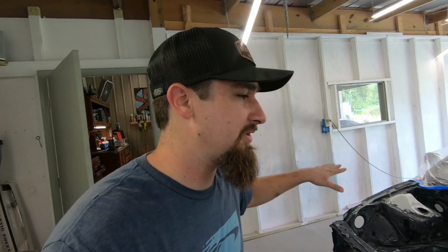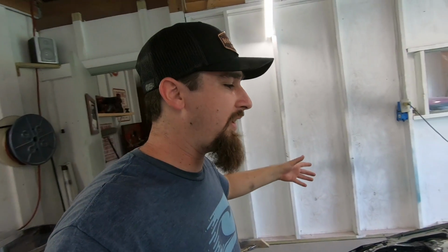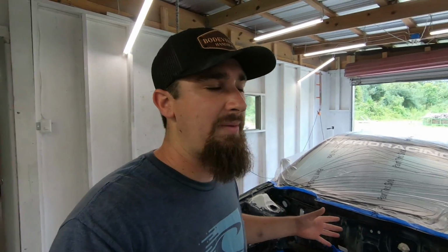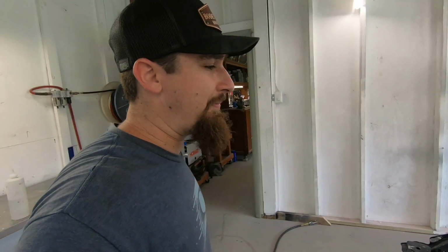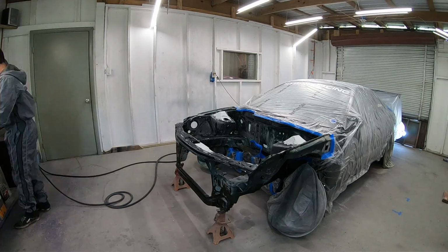What I'm gonna use is a filler primer. I'm gonna get it on there really thick, and hopefully that's gonna fill in some of the scratches, some of the inconsistent levels of old spray paint and old paint and even older paint, because this bay had been painted a couple of times. So hopefully by using that thick filler primer, it's just gonna give me a nice shell over everything. Then I'm gonna sand that down just a little bit before I do my base coat. But let me not get ahead of myself. Let's just get this primer mixed up and then go for it.